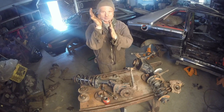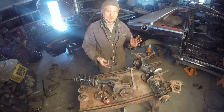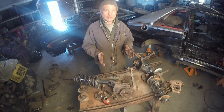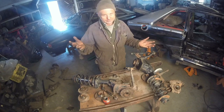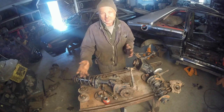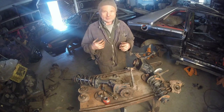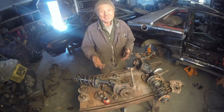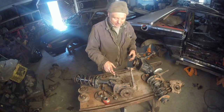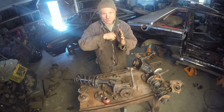The wheel will be 0-degree camber. Ford Motorsport, even in all the literature for the Sierra builds, all stated that if you keep 0-degree camber on your rear wheels for a 2-wheel drive car, mind you, but this is 4-wheel drive, but we can assess that, any advantage is any advantage. They got faster times. And I don't want the tires to wear. So if we have 0 camber and don't have tires to wear and get benefits of coming out of a corner, so be it. We're going to have to do that, because we'll open it up and we'll put metal inside and run it and weld it up like that.